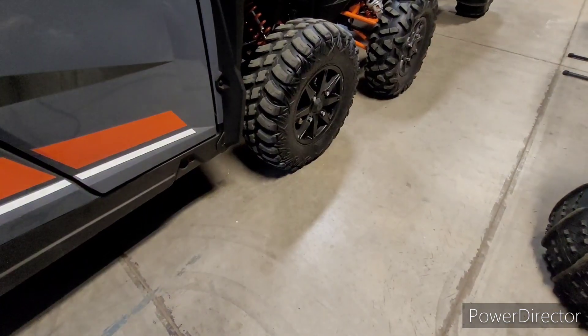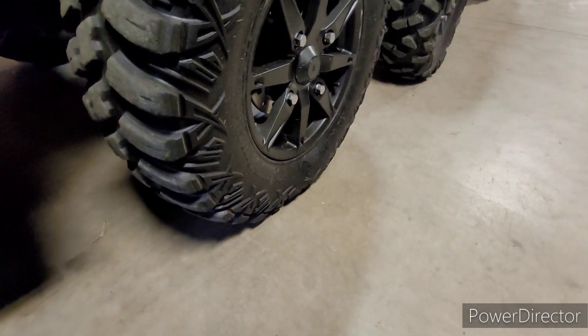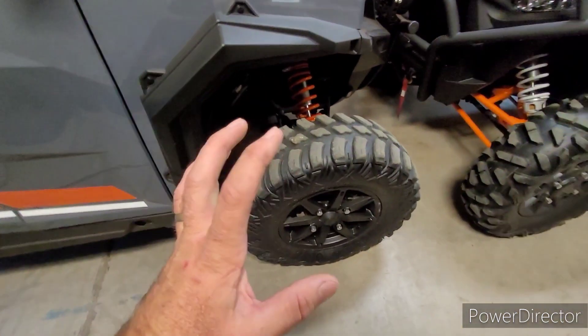We've been talking for about 10 minutes. If you've got any questions, go ahead and comment. If you don't know about the difference with running different tire pressures, that's a good idea of what I do. You've got to use your judgment and you should always go off the manufacturer's recommendation for safety. It all depends on terrain — if you're rock crawling up some big rocks, you want that tire a little lower on pressure. You can see this one has a little bit of a bulge to it because it currently probably only has about five pounds. It'll just flex over all the rocks.